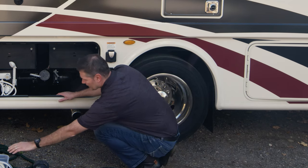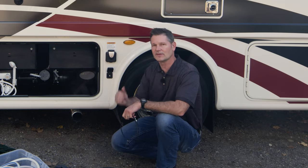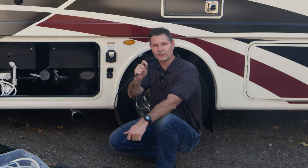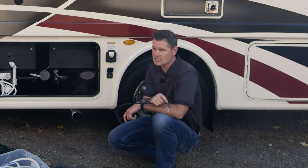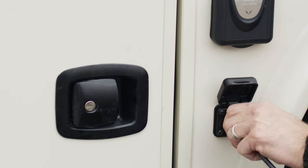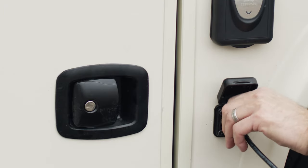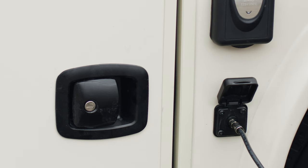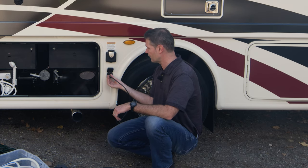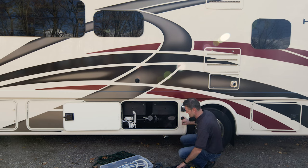Right down below, let's talk about cable. If you have some coax and the campground offers a cable connection, it's really easy — just like your house, twist the coax cable in, run the other end over to the campsite, twist that in, and when we go inside we'll show you how to switch between the antenna on top or cable programming.